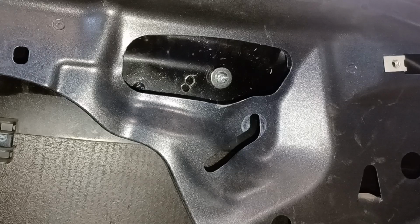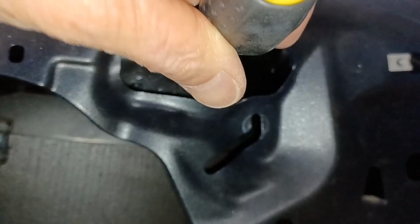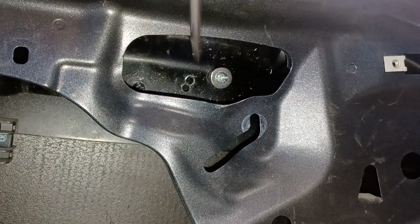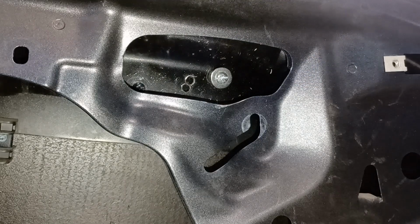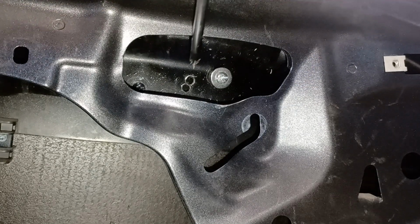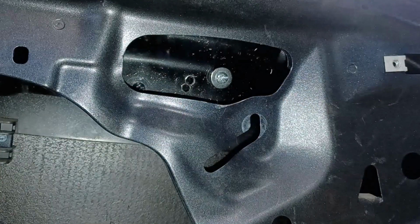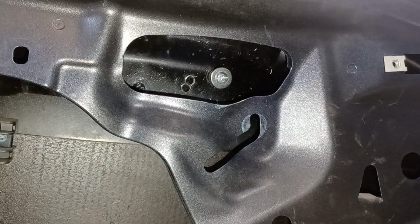Now what I did do was to make absolutely sure that I'd got it stuck, I used this hole. I probably can't do it now because it's screwed up, but I basically put a screwdriver through the hole, through the other hole, and levered it up. Obviously you've got to be careful that you don't split the glass, but you can put a fair amount of force on it, and that jammed the glass up into the top rubber. And then while it was in that position with the other hand, so I'm sort of juggling this, I drilled the hole. I drilled it at a slight angle on purpose because my idea was it will pull the glass up into position. It's all a bit Heath Robinson, but it does seem much better.